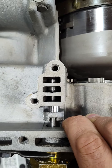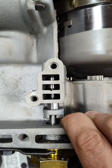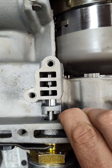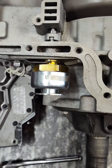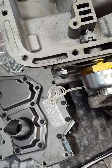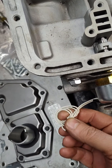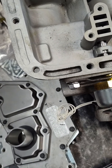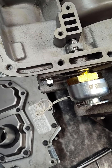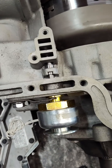When it's engaged again, you want to make sure this is blocked off so the oil is transferring between these two passages. You can see that open up nicely in there. You don't need a lot of opening into there, but at least a good 20-30 thou would be nice. One other thing — on the wiring, some people ask which one's positive and which one's negative. It doesn't matter; it's just an electromagnet, so polarity doesn't matter.